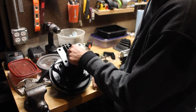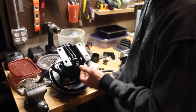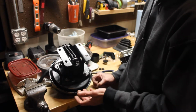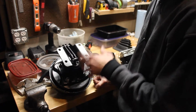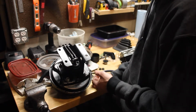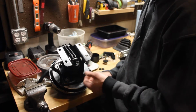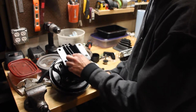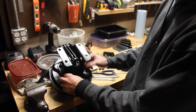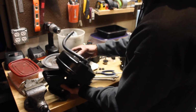But you basically heat up whatever it is, a piece of steel, to about 500 degrees, and then you dip it in used motor oil 4 or 5 times. It catches fire, and then you burn it off, and it leaves this great patina on there, and it becomes permanently waterproof. So it's a really neat way of preserving some of the bolts that you can't replace, or if you wanted to keep it as original as possible. So that's all been done, and this obviously has been replaced with stainless steel nuts and washers.